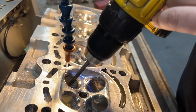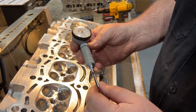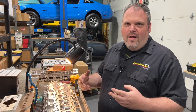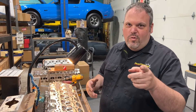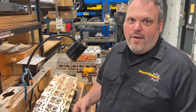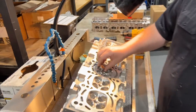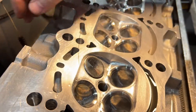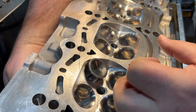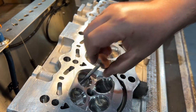Now the guide is sized. To verify, we use an inner diameter dial bore gauge — we stick it in and it reads perfectly where we want it. If we're going to be off, we want to be off big, not small. Too loose is fine; too tight is a problem. The valve can now go through — it wouldn't before — and the clearance is correct. See, it spins, even though it's dirty. You can wiggle it. We have the correct clearance.